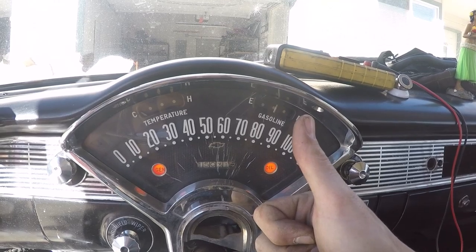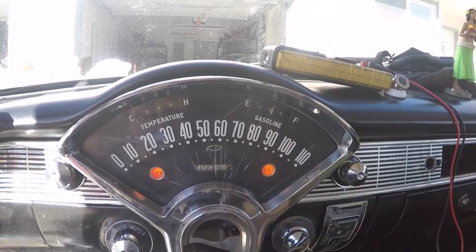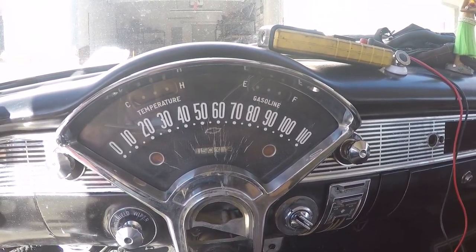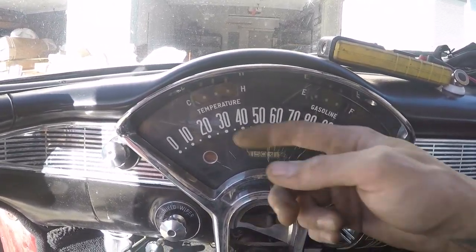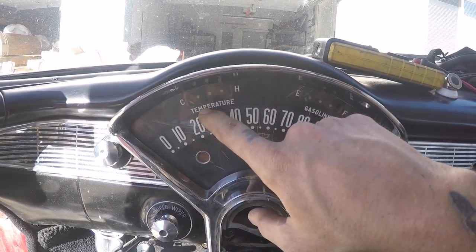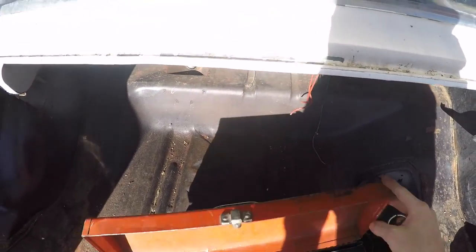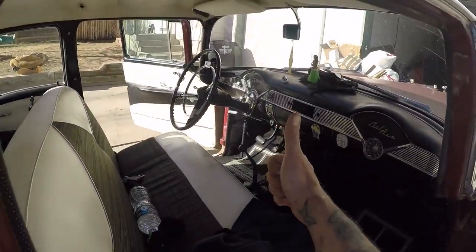Now with our wires all connected and a nice ground, we should get a more proper reading on the fuel gauge. We did it — the float works, the fuel sender works, the fuel gauge works, and the wire between the two is not grounding out to anything. It's just that the tank wasn't grounding itself to the body well enough. Now that that works, I can move on to the hot/cold temp sensor and see what that is — hopefully the same thing. These things don't tend to break; I inspected it and it looks just as new and clean, so my guess is either the wiring's wrong or the temperature sensor is bad. If you like the video, smash that like button; hit subscribe to see my videos as soon as they're uploaded — and as always, keep on modding.